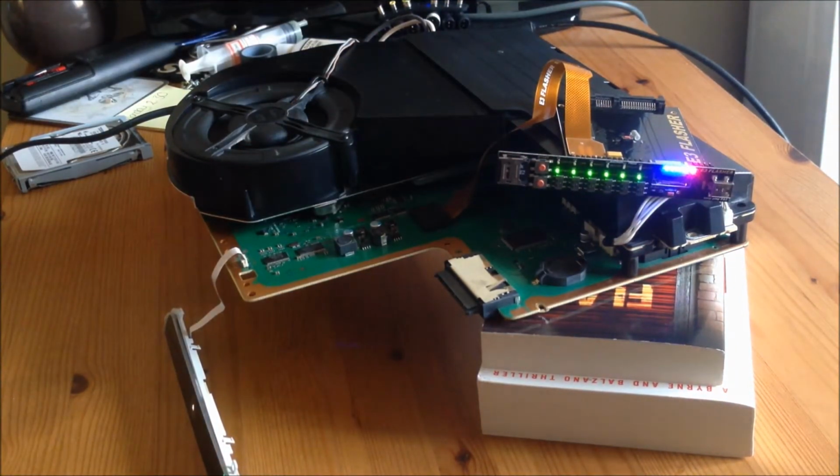What I normally do, because I don't really like messing around with them, is put the clip onto the Nor chip and then just clamp it down straight away. It will then take a dump first time, and it will be a good dump, and it normally minimises problems. If you try and take a dump of the E3 like this, you have to have a little bit of luck, but you also have to have a nice newish clip, or one that hasn't been through the wars, and the Nor chip needs to be perfectly straight.